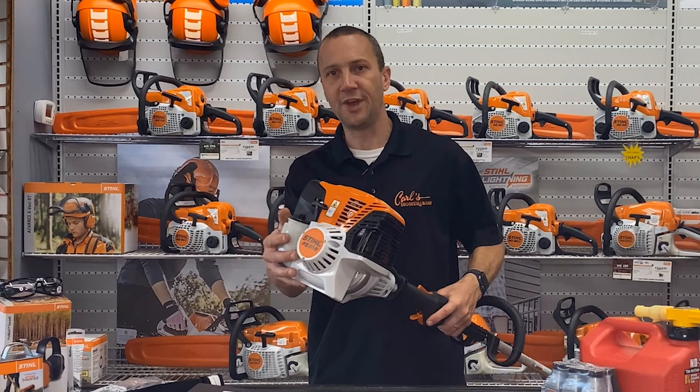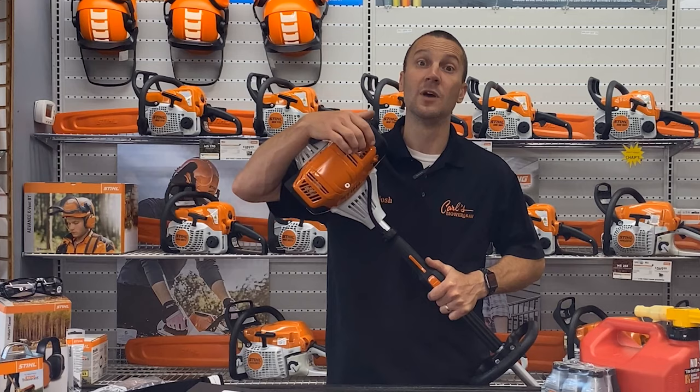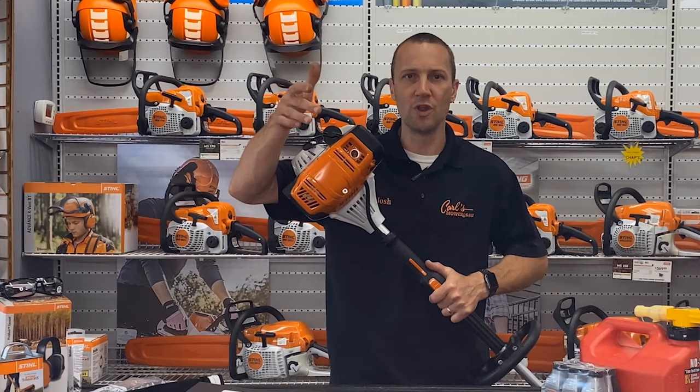I've got a primer. I'm going to push this primer a few extra times this time, but generally speaking I pump it four or five times. Pushing the primer a million times is going to waste a lot of time but it's not going to hurt anything. Four or five pumps is about the right number — don't worry if you get more than that, you're not going to flood it or cause a problem.